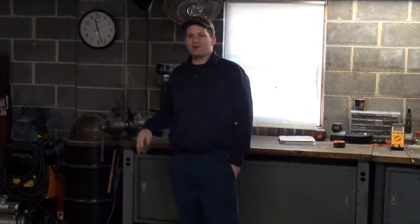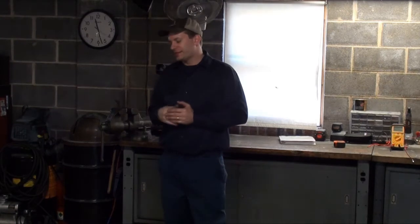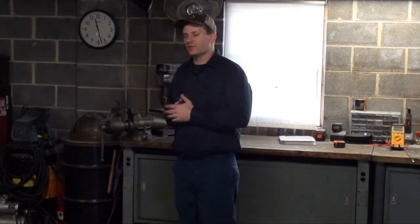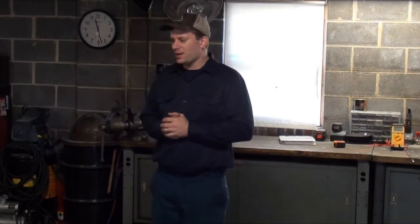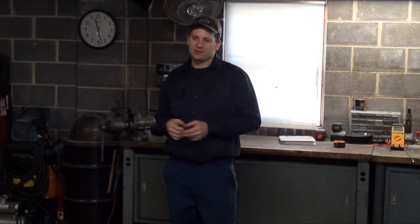Well, yesterday I got a phone call from a good customer of mine. If you go back about 9 months ago, I made a video on how to troubleshoot and diagnose a bad starter. Well, Mike's on the phone and he says, "Hey Will, this is Mike. My Ford Escort's not starting." I said, "Oh, get out of here. Don't tell me that new starter went bad already. What's going on?" He says, "Well, when I turn it to start, nothing happens. I don't hear any clicks. Headlights are on, they don't dim down."